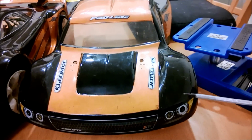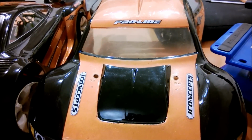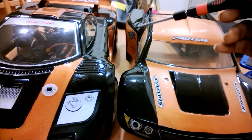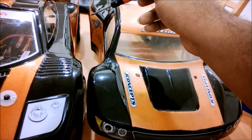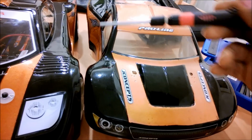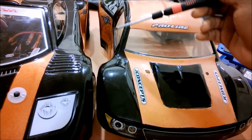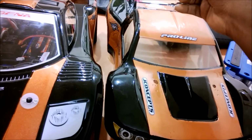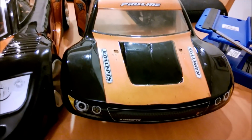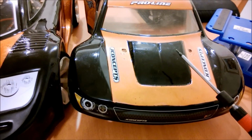Like things like this, where you have the wide fenders and coming in and the flare and then flaring back out again. Now that looks really nice, and it's more aerodynamic than just having a wheel just sticking out banging against the air. But each of these curves costs you something. Back here, this becomes a negative pressure region. That's like a drag chute. And you hit here and then it makes another drag chute. Now, like I said, it's better than some of the alternatives, but not the most efficient aerodynamic shape.